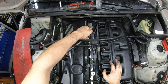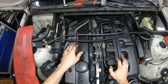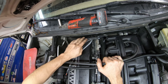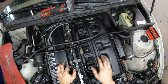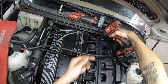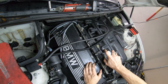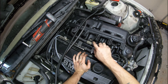Next we're going to lift up on this connector and get this out of the way, do the same with this one. Just get those wires out of the way - you can leave them plugged in. Same with these oxygen sensor connectors, just route them all over this way and get them up out of the way. Now I'm going to remove these T25s down here and lift up this air pipe pump out of the way. Just going to take some silicone spray - it was stuck up on the O-ring.